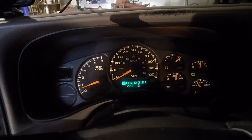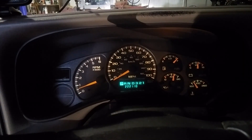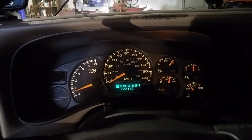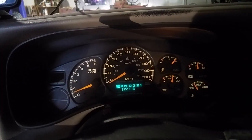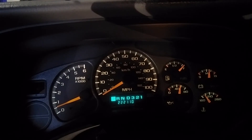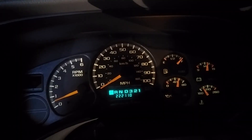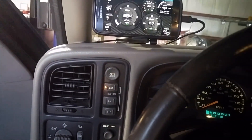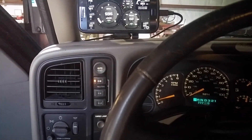It's been a week of driving since I did the EBCM resoldering — and all week, no lights whatsoever. No oil warning, no ABS light, no brake light, besides the normal test when you turn it on. Let's hook up the scanner and see if there are any ABS codes.